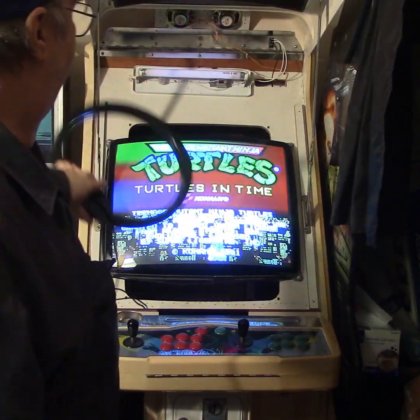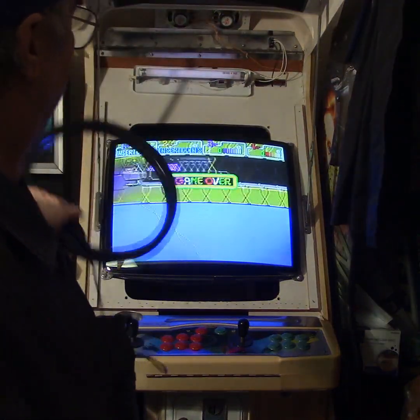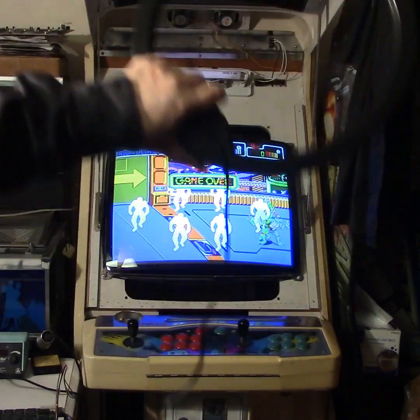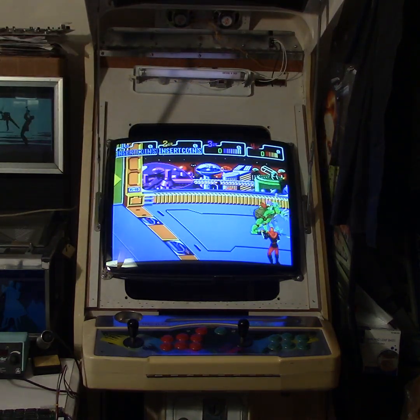And you just bring it around, get the circles larger as you go. Bring it back away. When you get far enough back, let go of it and that's it. That's how you degauss a CRT.